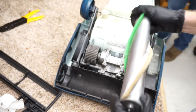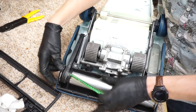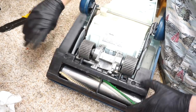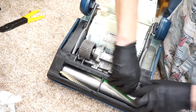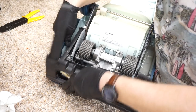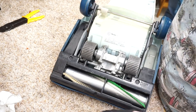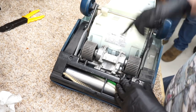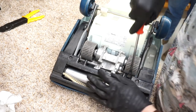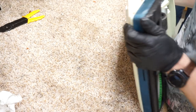Rebuilt the brush roller. We put the ends in. And we're gonna put this. And if it doesn't go in smooth, don't force it. Realign this. There we go. And a trick to putting these tabs on, if you don't want to use your fingers, some people have real trouble with dexterity in their fingers, you can just wedge a screwdriver on there like that.